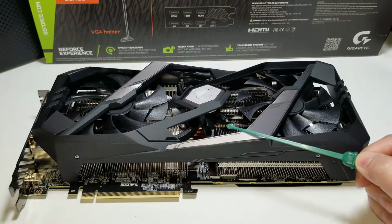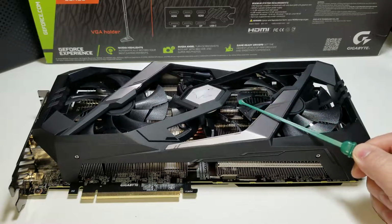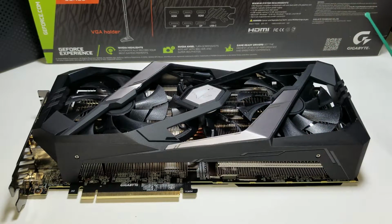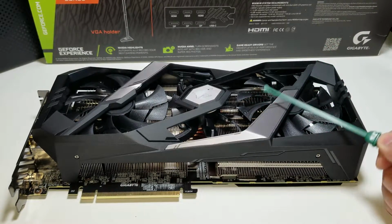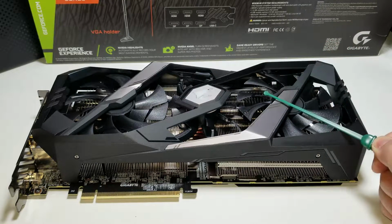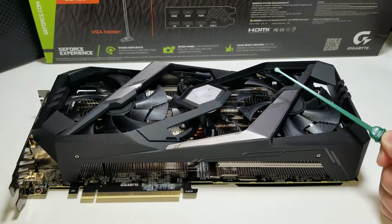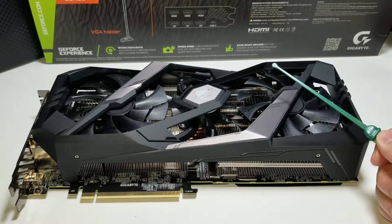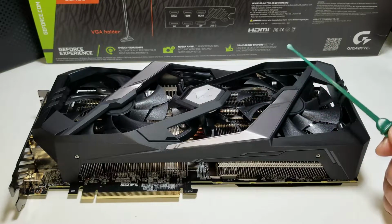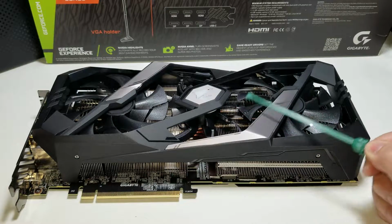So again, what I'm trying to say is, if you're going to overclock anything, make sure you have an aggressive fan profile to be safe. And with this graphics card, you need an aggressive fan profile for the LEDs so it doesn't bother you. You'll see in a video coming up. And also make sure you get the core clocks to be stable at 2040 plus. 2040, 2055, 2070, I don't know why they fall in those increments.